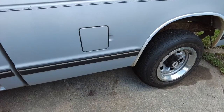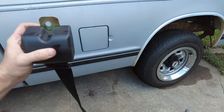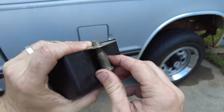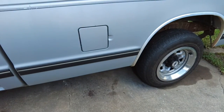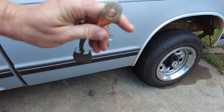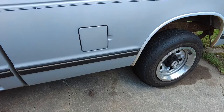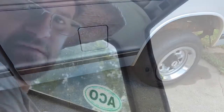Be sure you do not damage the existing bolts because they have to go in your new kit. The new kit bolts don't quite fit the existing holes, so you've got to drill them out. You also have to drill out the buckle holes as well — I bent one trying to make it work better, but you have to drill these out. They don't fit automatically on the S10 because you have to use the original bolts since the ones that came in the kit don't quite fit.